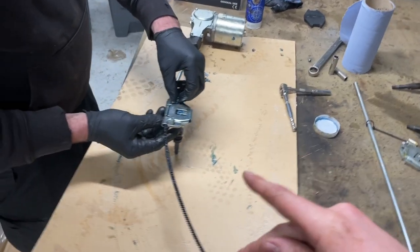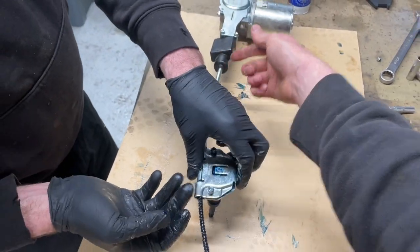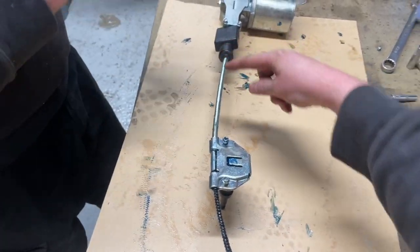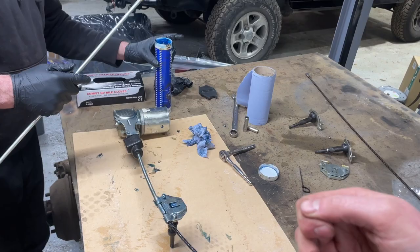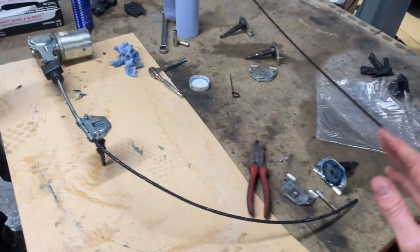That's a quick tip, actually. Me and Leon are just talking about it: don't do up that tube, don't do up these, leave everything loose. Obviously nip them up slightly, but because this pipe has a slight bend in it, you want to make sure when you offer everything up, everything has enough slack to find its position, then you tighten everything up. Test the operation whilst the dash is all out still, just make sure that everything is correct, and obviously then you can reinstall the dash once everything works.